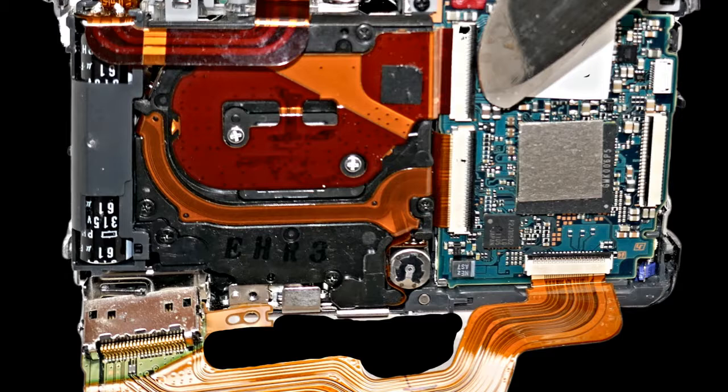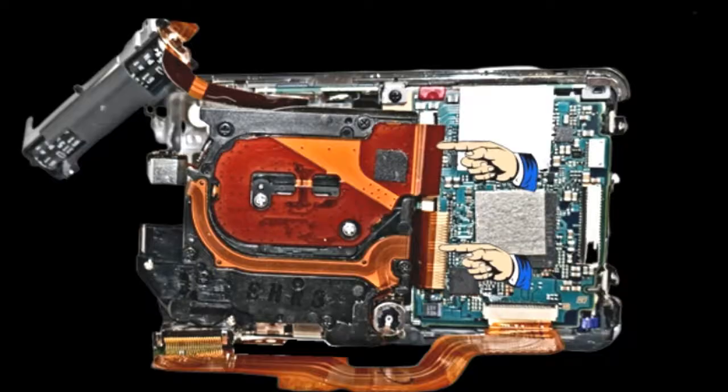Now we're ready to disconnect the lens from the circuit board. If you use the butter knife to lift up that little thin plastic clip so that it'll release it, you're going to do it on both of those clips, the one where the knife is now and the one below. Once those clips are loose, as you can see in the picture, you can just pull them out, and that releases the lens unit from the circuit board.